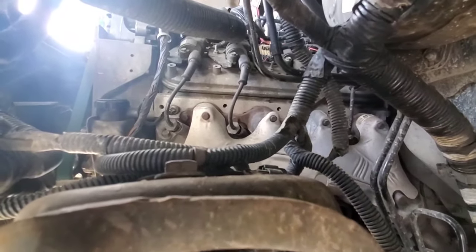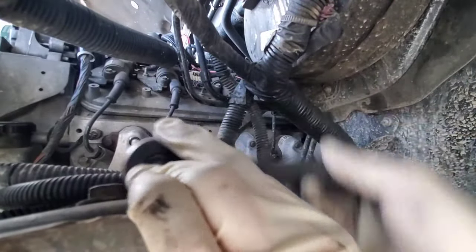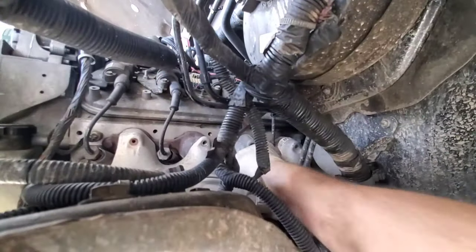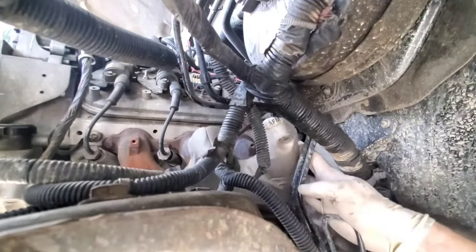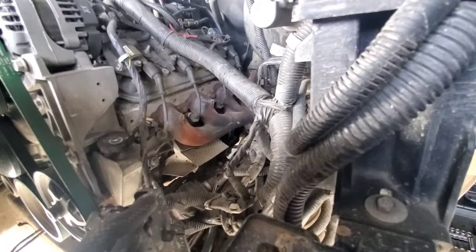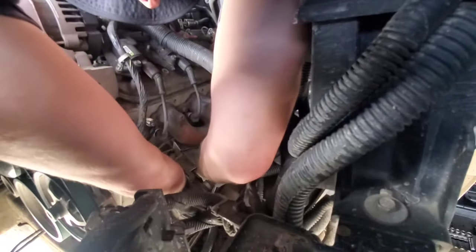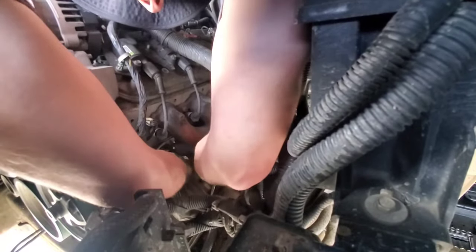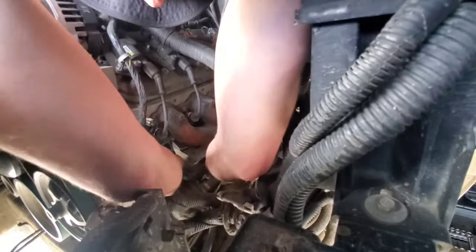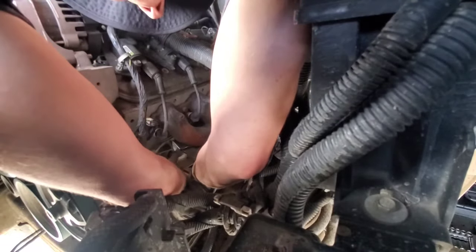There's supposed to be five of these bolts, but I had the weight reduction kit — I think someone's been in here before and there's only four on mine. I'll pick up some bolts later. Now we can start working on the engine mount. The engine mount has four bolts that connect the block to the mounting plate, and the mounting plate connects to the engine mount, which has three bolts that connect it to the frame.